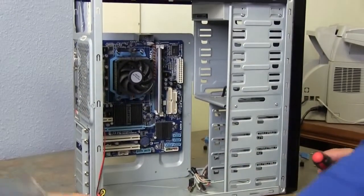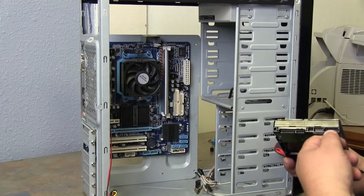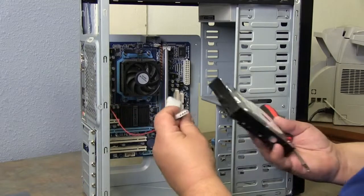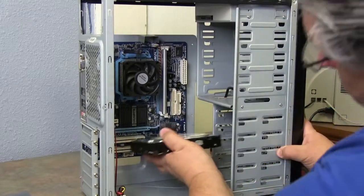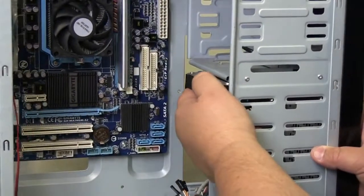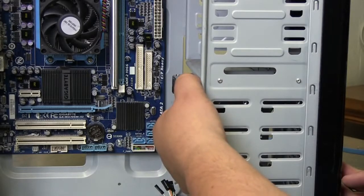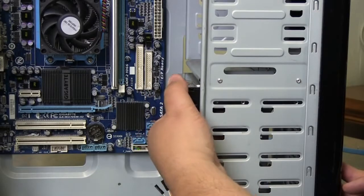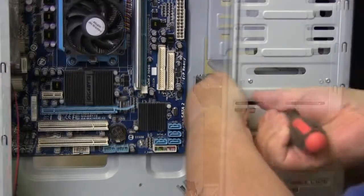Now that the CD-ROM is in place, add the hard drive back. This hard drive has both IDE power and SATA power connectors, so you can use either from your power supply. We're going to find our ledge, slide it back in, and notice our screw holes line up into the slots. Slide it as far back or as far out as needed — the adjustment is up to you depending on available space. Take your screw and line it up so it doesn't slide either way.